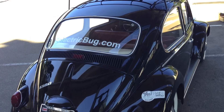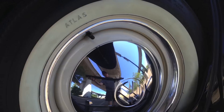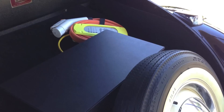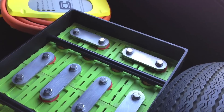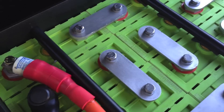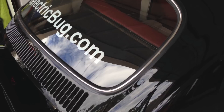Let's go around to the front of the car. Remember, there's no engine up here. Instead, we have one of our two battery packs, right where the gas tank once was. We even used the same bolt holes that held the original tank in place. Only now it's much stronger — it's made with 6061 aircraft aluminum. There are 37 of the 160 amp hour batteries — the little green boxes there. There are 12 up here, and 25 more behind the back seat. They're from Voltronix.